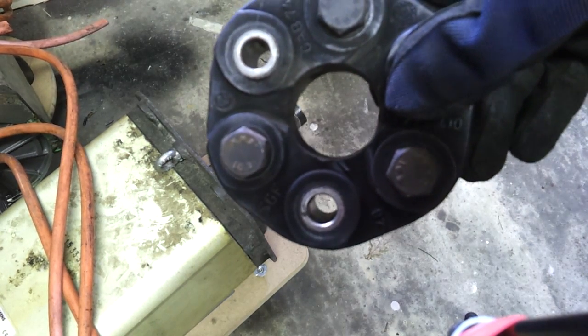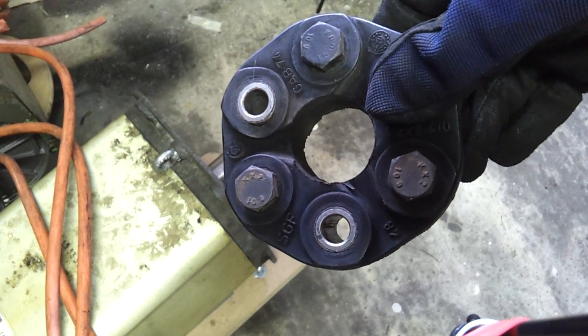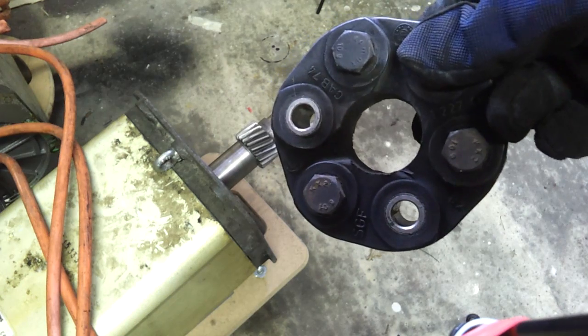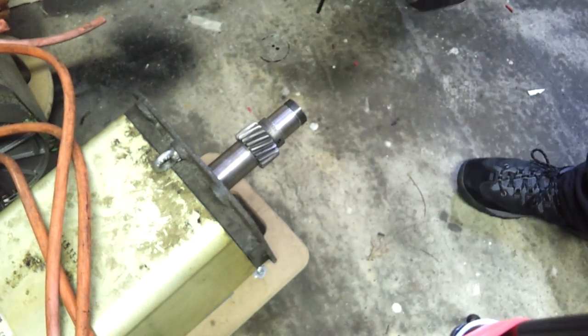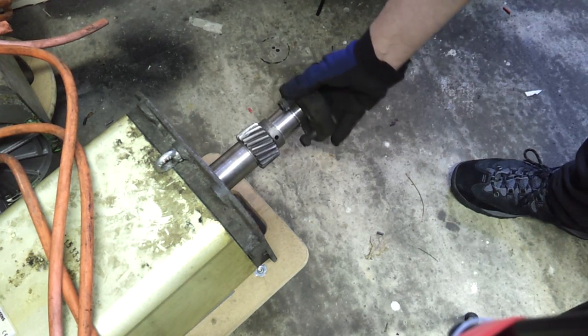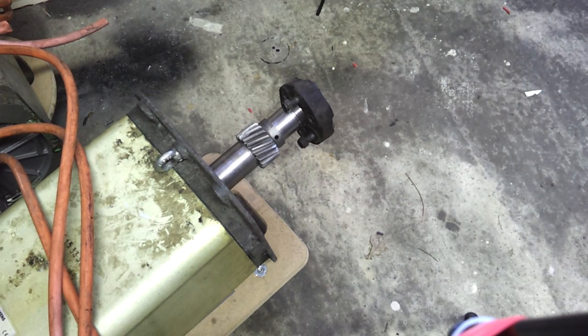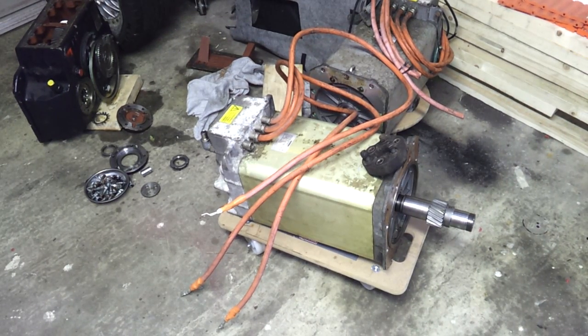When we get our engine and automatic gearbox pulled out, we're going to go to work on it with probably an impact wrench and an angle grinder. We're going to take out the driveshaft flange, which one of these doughnuts will connect to, and then we're going to mate that driveshaft flange up to our little friend here. That's going to give us a driveshaft output so that we can turn the 46 driveshaft. Thanks for watching guys, and stay tuned for some more drift car updates.